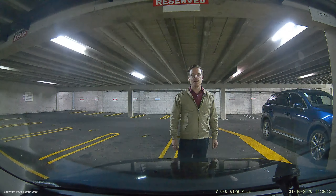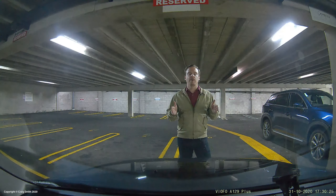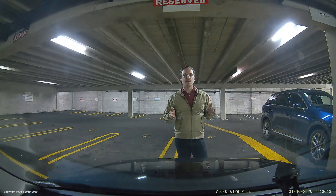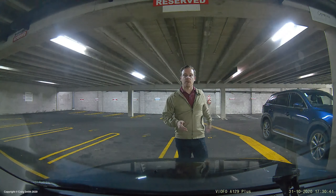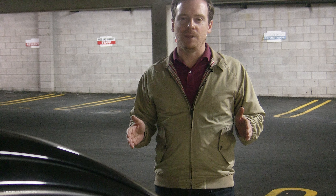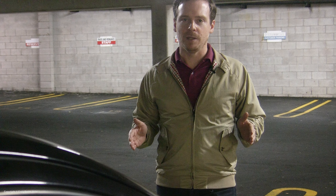Another issue with buffered parking mode relates to the 45-second clip: very often you'll get an event sufficient to trigger the motion sensing and the camera faithfully records that 45 seconds. But if motion then calms down — say someone walks into frame and then just stands still — you'll get to the end of the 45 seconds, it stops recording, and you won't have anything beyond that. That can be quite a drawback that the other modes, which record continuously, don't suffer from.